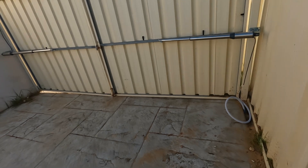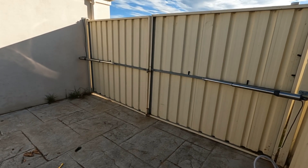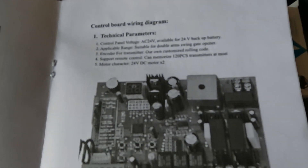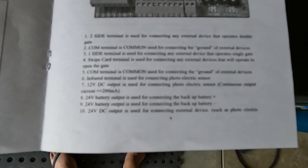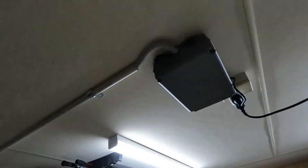One shortfall: you can't stop the RAMs halfway using programming — they've got to be fully closed or fully open with this kit, no in between. There are more advanced features in the manual — swipe cards, turning spotlights on, an alarm if the gate opens without authorisation, soft starts, and automatic closing. So if you drive through and take off, you can have the gates automatically close behind you. You can pause on the manual screen shown here to read up on those. The final install looks good — box is mounted, wiring is tidy, and it's all working.